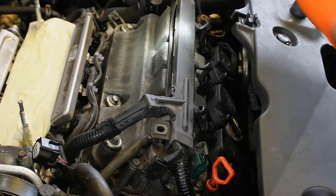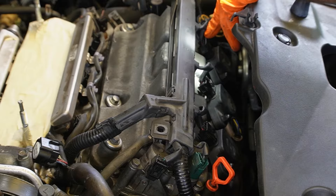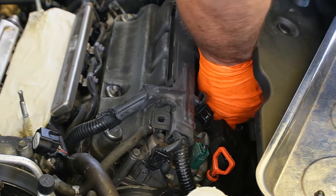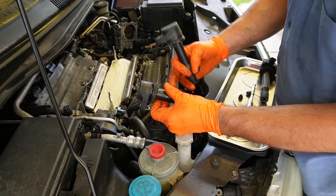Now that we're ready to remove the valve cover, before we get to all the plugs, let's go ahead and remove all of the coil packs along the front. It's always a good idea to inspect the coil pack. I have all six to replace and I'm going to be replacing all of them — even though there's just one broken — because they all have around the same age, so it's just a matter of time before the others start breaking down.